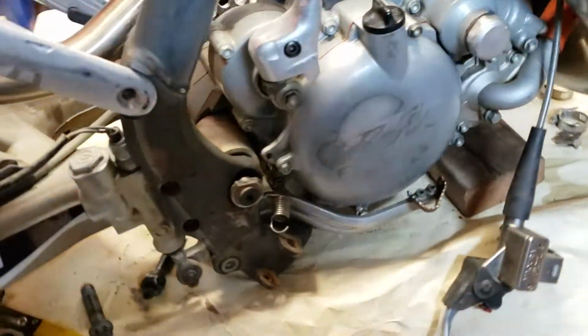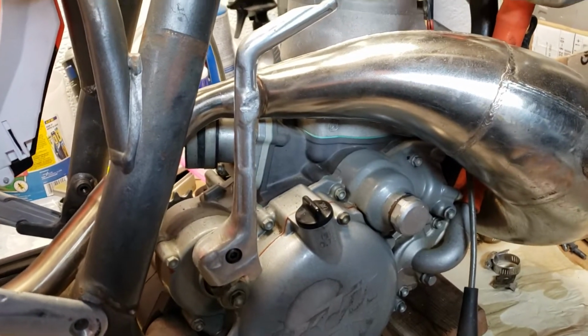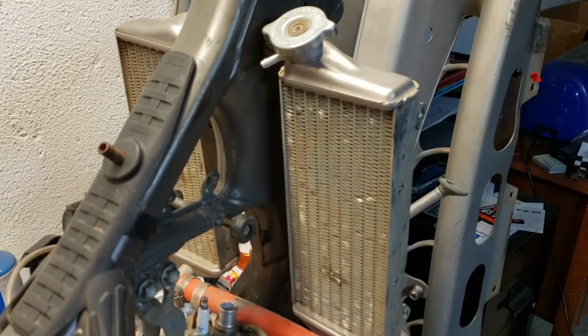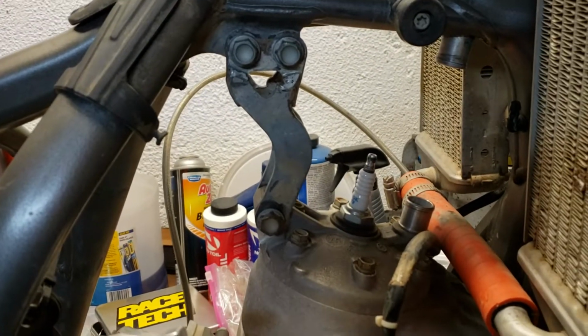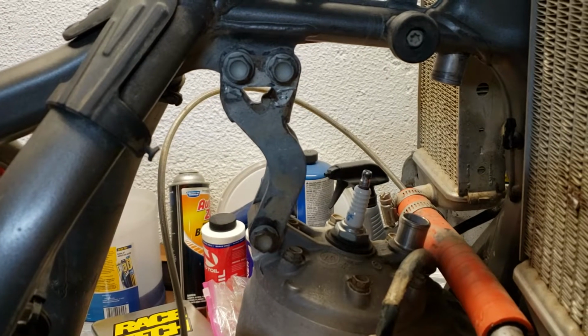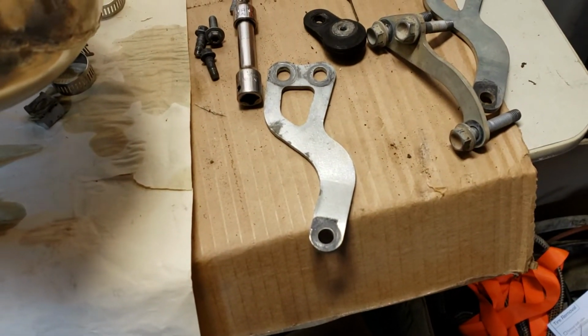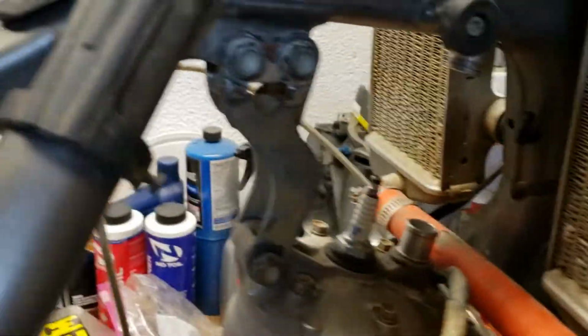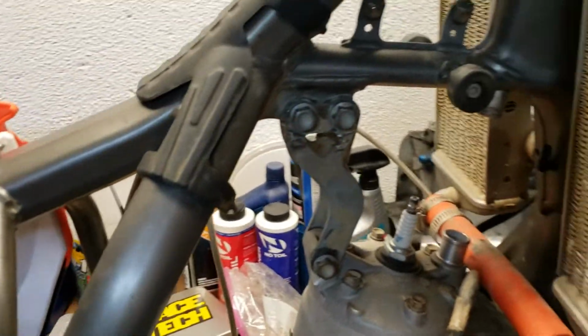Motor, boom, right in. Everything with the swing arm bolt to the motor mount bolts down below worked really good, fit good. Radiators, fitting good. Only thing that wasn't fitting good was the stock mounts that I had off my 08. And then the seller of the frame gave me these mounts, and these end up being too long, and he gave me these hacked up ones that, you know, they got some bubblegum welds and everything, like someone was in there doing some custom work. Well, lo and behold, those end up fitting, so go figure.